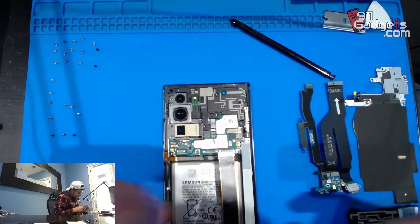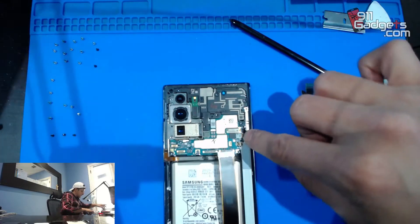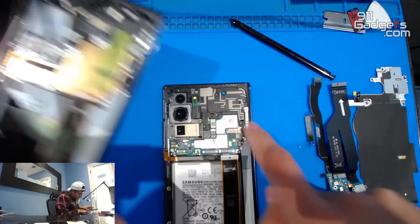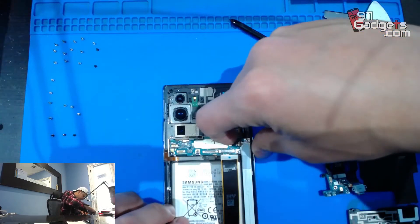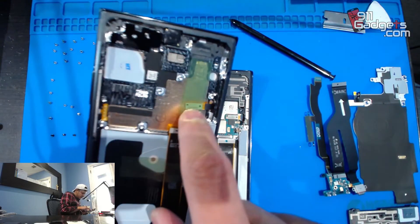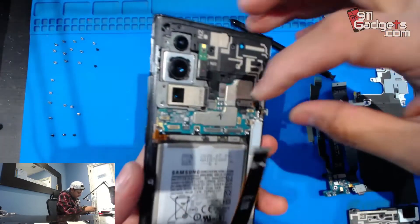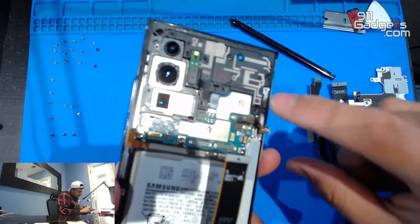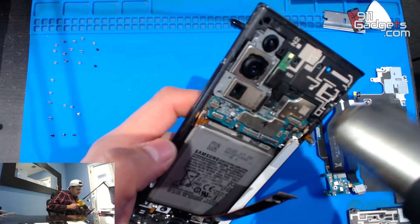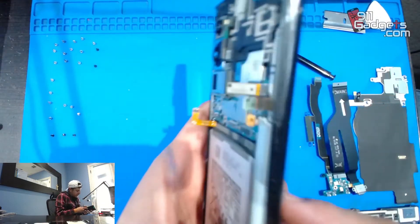Let's continue dismantling. Let's unplug the wireless pad for the S Pen. There's another similar connector up here — let's go ahead and unplug that. Notice there's another cable here that comes from the screen — we're going to unplug that too, but you don't have to unplug it to take the little bar out. Just an FYI, this screen still worked — it just gave flashes but it still touched, so I might keep it just for data recovery.